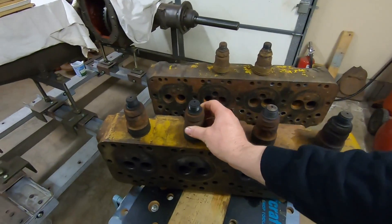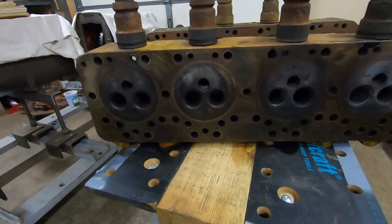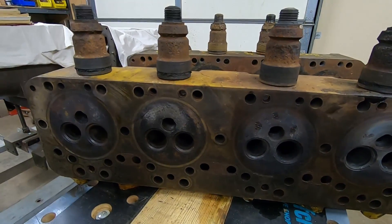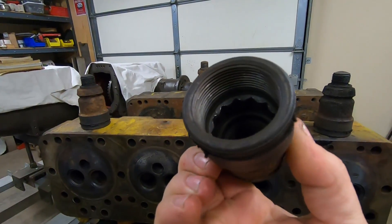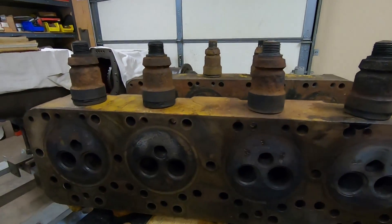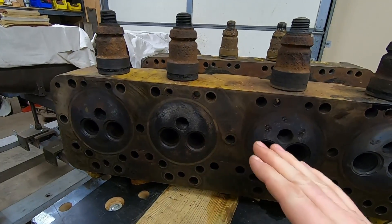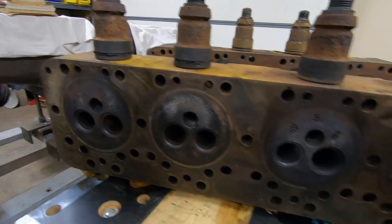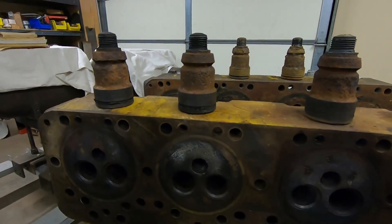They all look pretty good. They all did come out, but it wasn't pretty at all. We utilized methods on this cylinder head that we would never utilize on a head we were planning on using — mainly heat. We put the wrench on these things. To remove them, they all have a hex contour feature on the inside that you engage the wrench to turn these out. Number two came out without a lot of fight, but one, three, and four were increasingly stubborn as we went down the line. We used plenty of heat because we were not afraid to damage the head — it was all about salvaging those chambers.